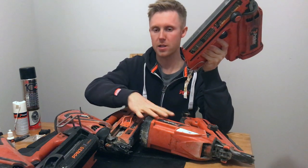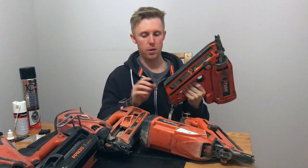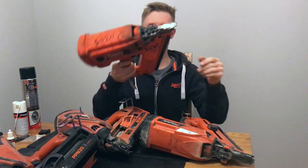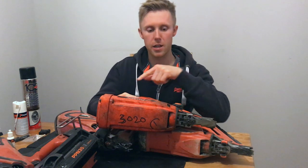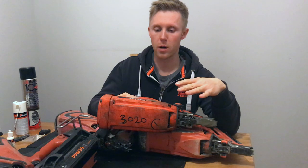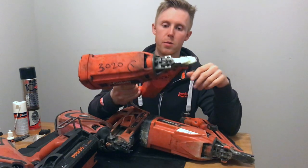The 350+ just hasn't got quite the same power as the 360. But if you're looking for parts and can't find anything for the IM360 CI — if you look on eBay or whatever — the original IM350 shares the same O-rings as the new 360, and also things like the reed valve, and there are a few other bits and pieces that might be similar as well.